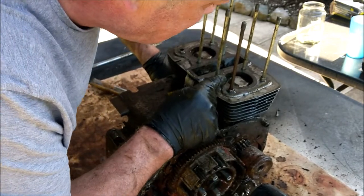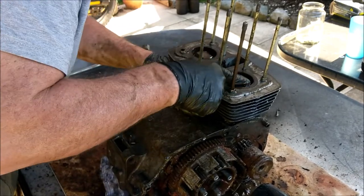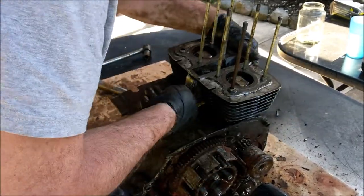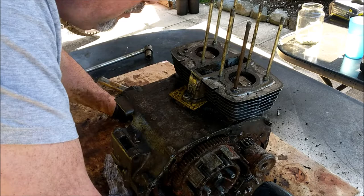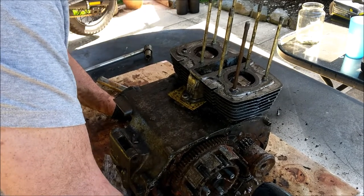And I'm sure I can see a little bit of bore now, where they've gone down literally a couple of mil, but they have receded. I've been banging these wedges in, malleting the side, malleting the fronts, putting more wedges in, and I'm up now about 11 mil gap between the block and the engine casing itself. So I'm getting there, but by jolly, it's tough work.